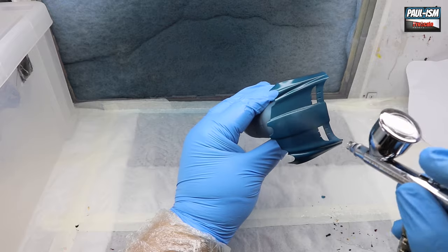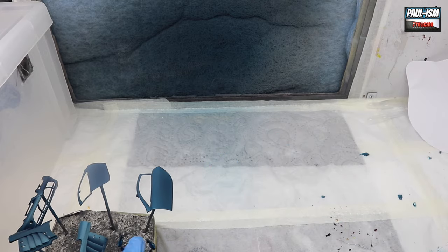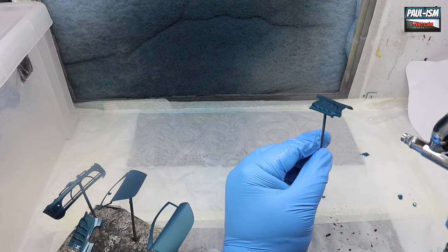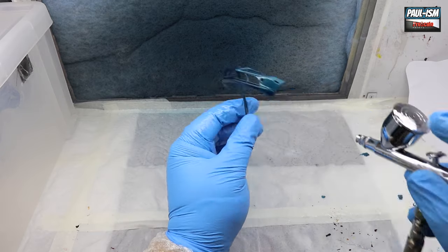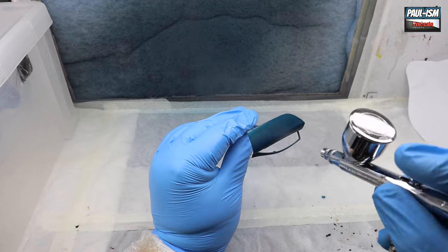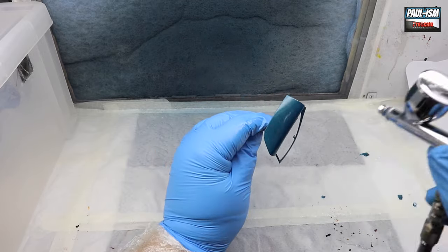2K is especially sticky, so be very careful that you don't touch any parts together because they will stick and ruin your paint job. With so many parts, you need very careful parts management when moving things around. We've got the body and bonnet as separate parts, everything else is mounted on this part holder, and I've got to juggle them around in the plastic case to keep them dust-free. The key is: get the clear coat on as quick as possible and pop back in the box as soon as possible.